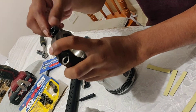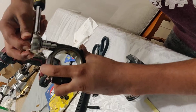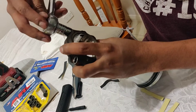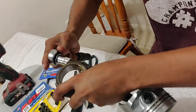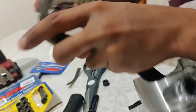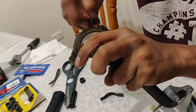Once you get the bolt through the rod cap, put the nut on and just torque it down slightly to see if the bolt actually pulls through. In this case it's already seizing in there and putting a fair bit of pressure, but the head of the bolt isn't anywhere near that flat surface, so I'm going to continue sanding.